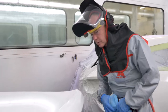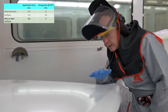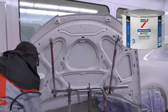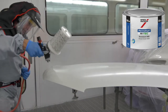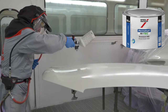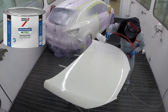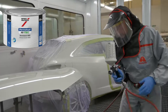That's the car done — now back to the bonnet. As you can see the wet on wet has flashed and there's a really nice smooth surface. Remember if there are any little pieces of dirt or any imperfections you're not happy with, you could de-nib this now. Five minutes have passed, so let me get the base coat on and I'll come back to you after it's flashed when it's ready for clear coat.